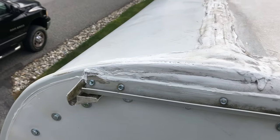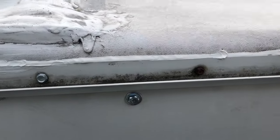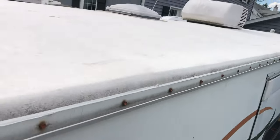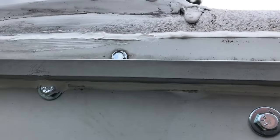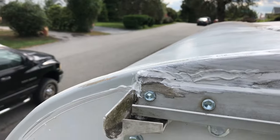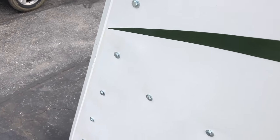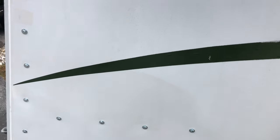Here's the final product — everything is put together. I put some new screws in the end of the channel and you can see the old screws. I did put a nice new bead of caulk across the whole top of the trailer, and a nice new bead underneath — you can see my bolt there. I probably could have come a little bit lower with that one bolt, but oh well. Everything is caulked up. It's actually one of my better caulk jobs, to be honest — I'm usually terrible at that. I'll probably go over some of the old seams with flex seal because I don't feel like re-caulking the entire trailer right now.